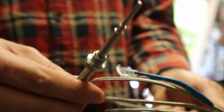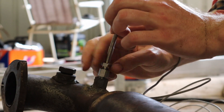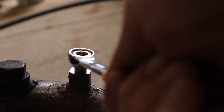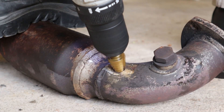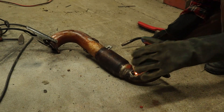This here is the probe for the EGT side of the gauge — it needs to go somewhere in the exhaust. You can fit it in the manifold, but it's more popular to put it in the dump pipe just after the turbo. If you have an aftermarket exhaust, you may already have a bung welded into the top of the dump pipe. The problem is mismatched threads — undo the bung and you might need an adapter. If you don't have a bung already, you'll need to go to an exhaust shop or weld one in yourself. It's worth buying your EGT gauge before getting an aftermarket exhaust so you can tell the shop what thread to use — it'll save a lot of problems.